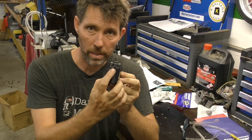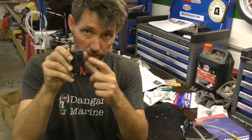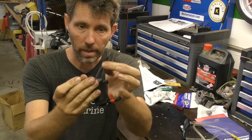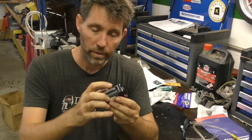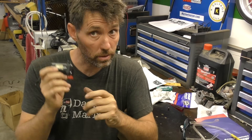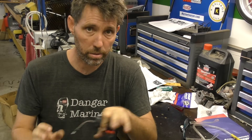All these do is have fuel come in through the large barb and send fuel out through the two smaller barbs under a couple of conditions. In normal run mode, when this little valve is pointed up along the body of the prime start, the fuel is shut off — that's your normal mode when the engine's warm. In that mode, if you send power to this purple wire, a solenoid inside opens and lets fuel flow from the large barb to the small ones whilst the solenoid is activated. That's activated by pushing the key in generally. So as you're cranking the motor you push the key in, it activates the solenoid, you'll hear a click, and you're getting that extra bit of fuel you need to get it started. When you let go of the key the solenoid closes and you're just running on the normal mixture provided by the carburetor.